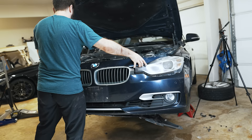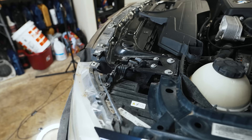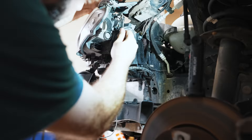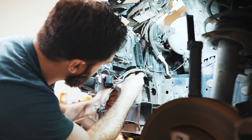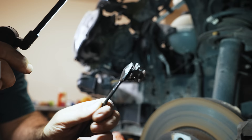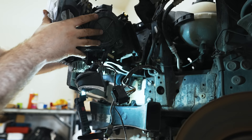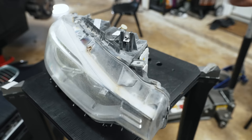From the top there's a screw here and a screw here, but I believe you could leave this in place and just go after this screw. Taking out this T30 up at the top — there's a 10mm here and a T30 here. For some reason those bolts had red Loctite on them, and the only way I got them off was by holding with a half-inch wrench from below because there's a captive nut in there. Now there are some T10 screws that screw into the lens.